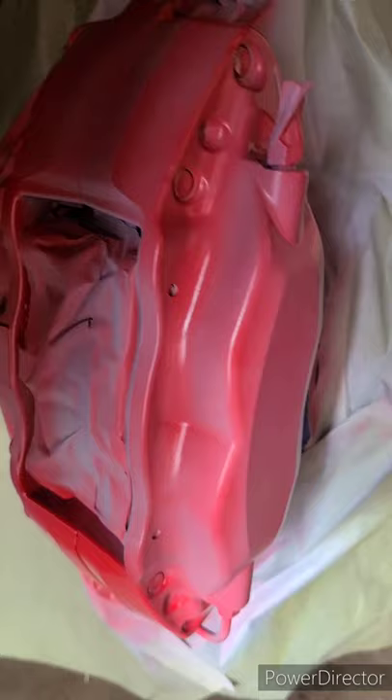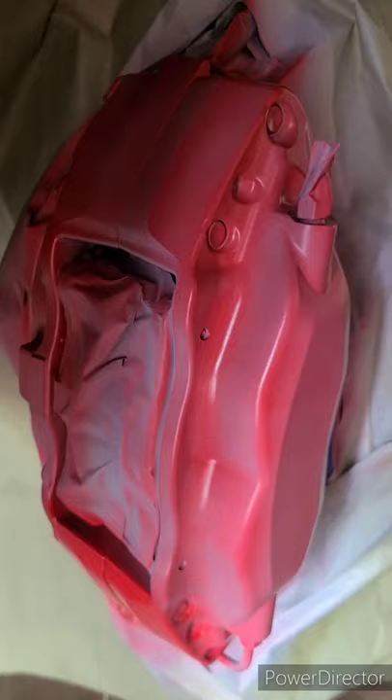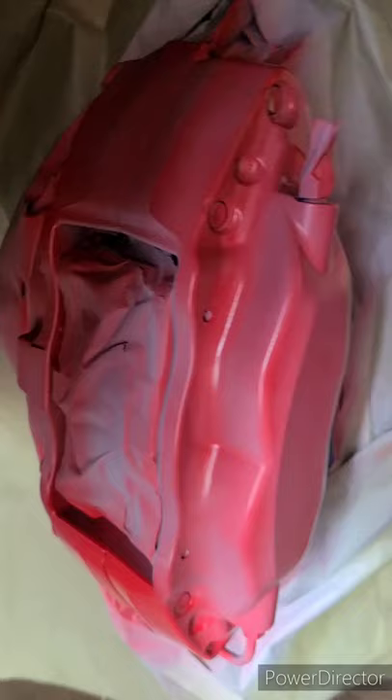I just did a slight dusting of the base coat on it, and I do that while the primer is still a little tacky — to make sure I get good adhesion not only from the etching primer to the metal, but also from the base coat to the primer. This allows everything to bind together a lot better and have good durability through the three layers of refinishing.